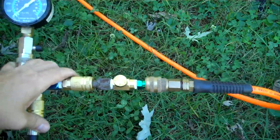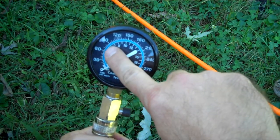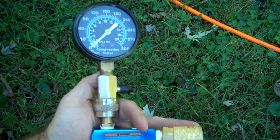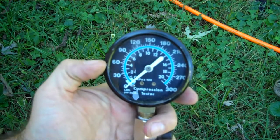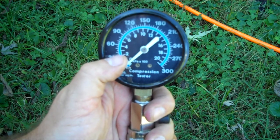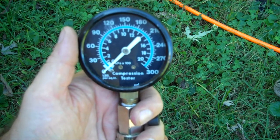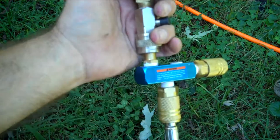The airline goes there. Let the air in very slowly and watch the needle climb up to wherever you want it — say 80 pounds or 60 pounds, whatever number you want. When it's filled up, pop it off. That locks the air inside the cylinder. Watch this needle — write your number down. If the needle starts drifting down, you've got a cylinder leaking down. They'll all leak within a given amount, but if one drops faster than another, you've found a bad head gasket, cracked head, burnt valve, something like that.